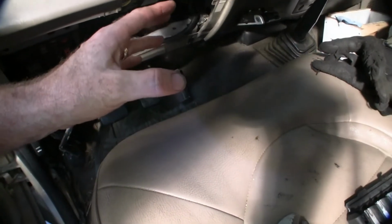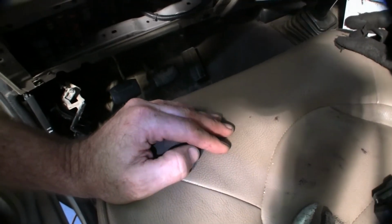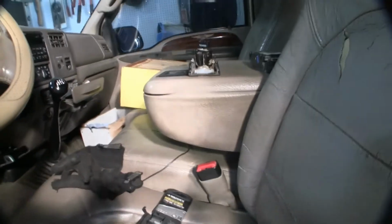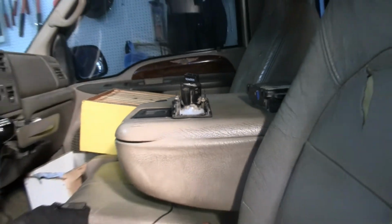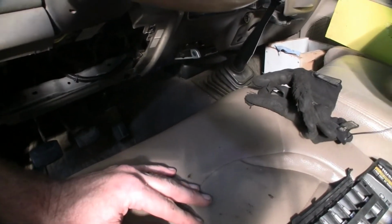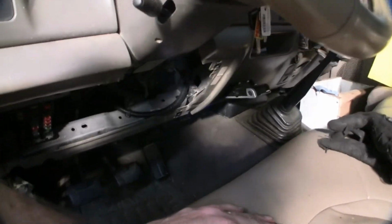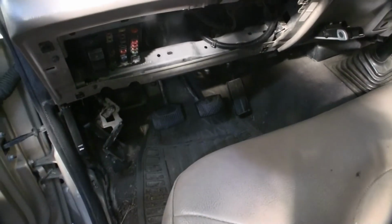This does have remote control. I may get some off eBay and program them, but the electronics have gone back to working like normal. I bet now my auto locking hubs may lock now. It's always worked with switching it to four-wheel drive, but I have to go out and manually do the hubs. So we'll see. I'm going to have to find some way to try to replace this wire, maybe that part of the harness I can replace where they screwed it up. But anyway, there it is. That's how to replace your GEM.